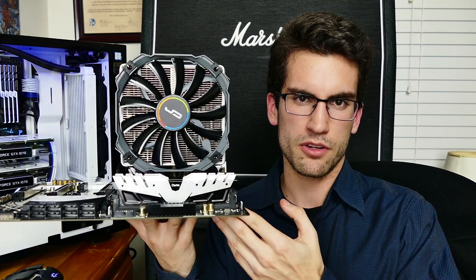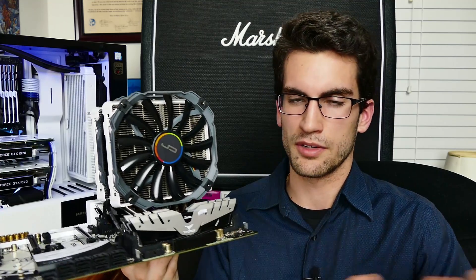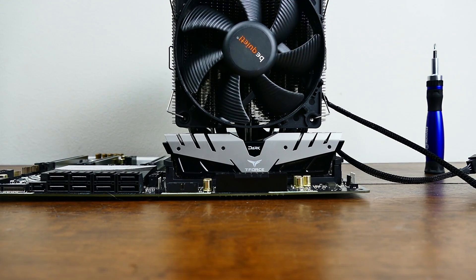I'll say one last thing before I end this video. If you're worried about price — I know 80 bucks is a lot for an air cooler — consider this: you could purchase a 240mm AIO for 100 bucks easy, but you should worry about pump failures, possible leaks, and maintenance in general. They're typically loud — the pumps themselves are typically loud. Or you could purchase something like this, which requires virtually no maintenance apart from the fans. If the fan dies, just replace it, no big deal. And something like this, or the Dark Rock Pro 3 especially, is very, very quiet. Just food for thought.